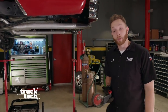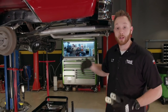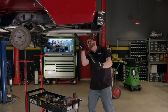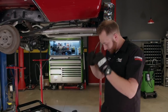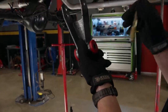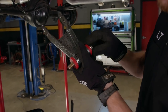We've got the front spring hanger installed, which means it's time to move on to the longer rear shackle, which will finish up lowering the rear end of our F-100. But I'm running into a bit of a problem when trying to take out the lower pivot bolt, and it's actually kind of common when working on older suspension parts. We can hit that thing as hard as we want and it's not budging — and that's a 14-pound sledgehammer. There's a steel sleeve inside the end of the bushing on the bottom of the shackle, and over the last 40-some years, rust and corrosion has formed inside that sleeve, basically freezing the bolt in place.